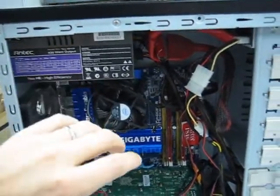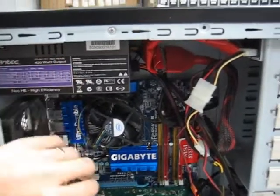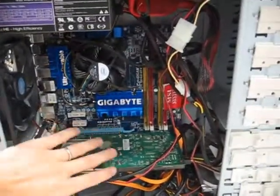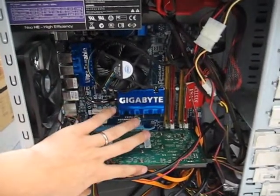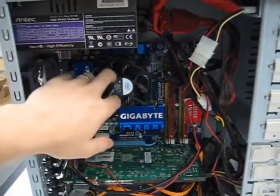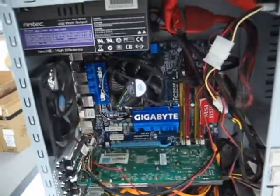The only other thing you want — for me, this machine is going to be in my living room, so I want it to be as quiet as possible. Make sure your power supply, CPU fan, case fans, and video card fans are all super quiet. The 9500 GT does make a fanless version, and since I'm not going to be doing much gaming, that'll be fine. I just need to make sure the CPU fan is quiet enough, and the power supply fan is pretty quiet. So let's go ahead and take it all apart and put it all into the new case.